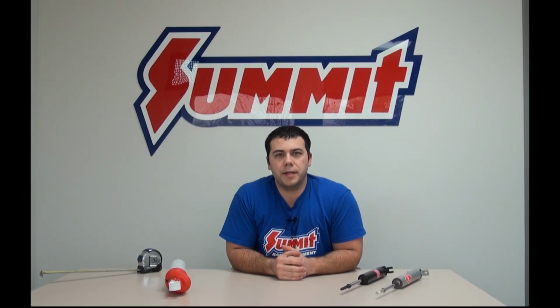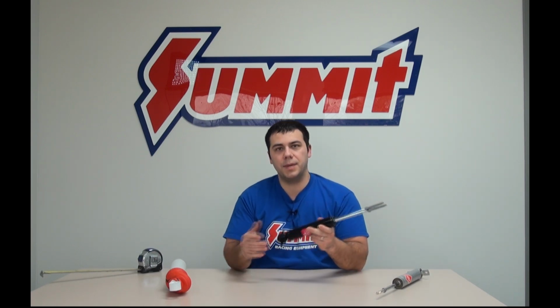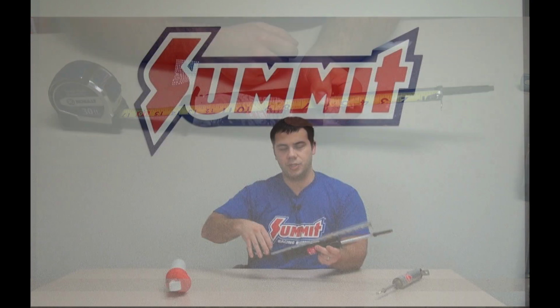So let's say you were already happy with the ride height of your vehicle, you never changed the springs, but you noticed you need some new shocks. Well, you're going to have to take a couple measurements just to make sure you get the right ones. One of the measurements is going to be the length of the shock extended. So you're going to take it from the eye to the end of the piston. And for this one, we get a length of 13.5 inches.